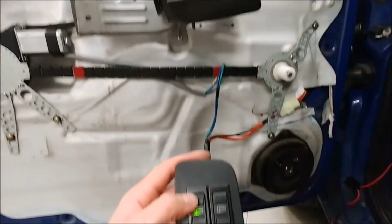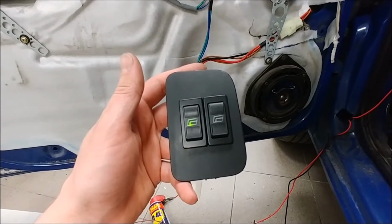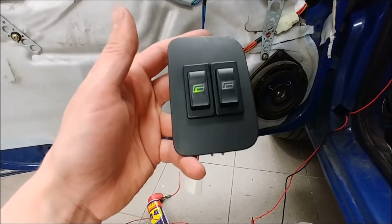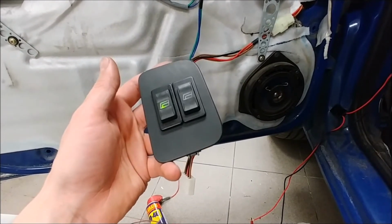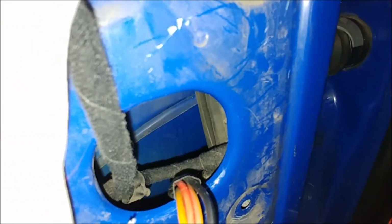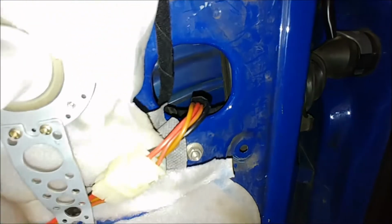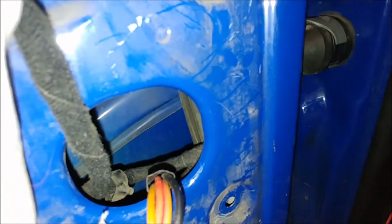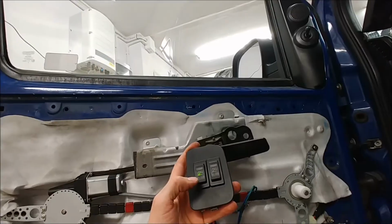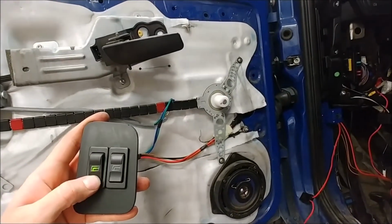Nice! It all works. And there's also a light, which means that I will not be able to connect it to the continuous 12-volt supply. Small issue detected. I accidentally passed the wires on the wrong side of the window guide and the glass hits the wires, so I need to reroute them. Take 2. Now the windows open and close with no drama.